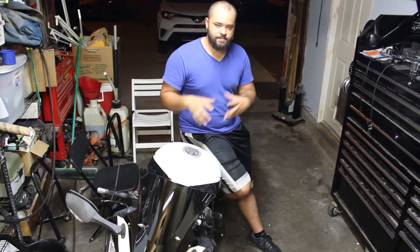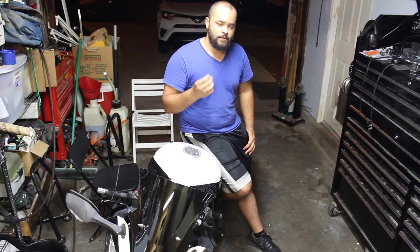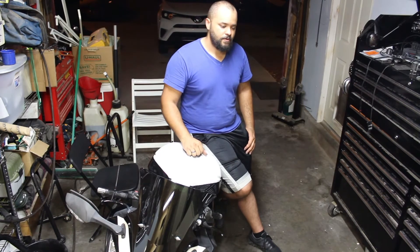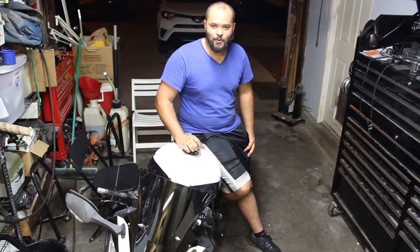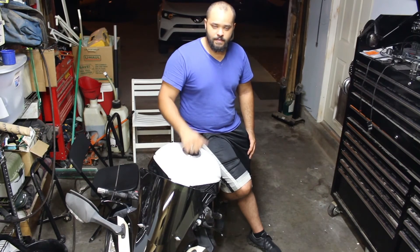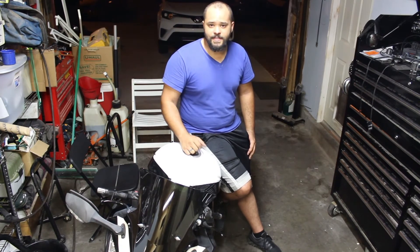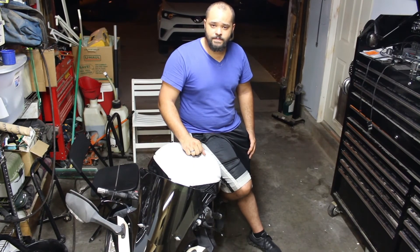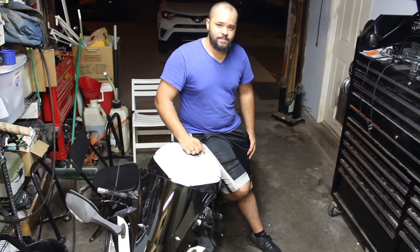Sorry I didn't explain in detail how to disassemble and reassemble the bike to get to the air filter. The whole point of this video was to explain how to clean and how to re-oil a K&N air filter, or any other air filter that may be similar to it. I hope I was able to get that point across. Depending on where you're at — if you're in a desert like me, probably doing it about every 3,000 miles is what you should be doing before it gets really gunked up. If this was able to help you, hit that like button, put a comment, let me know how I'm doing. If you're not a subscriber, definitely subscribe. The whole point of my channel is to help people save money and keep their bikes away from the dealership. I'll see you guys in the next video.